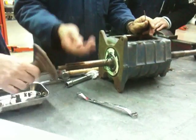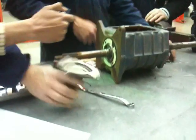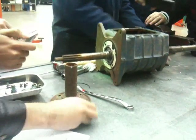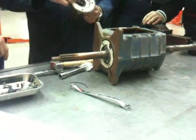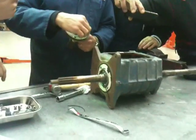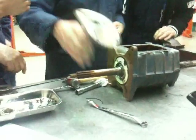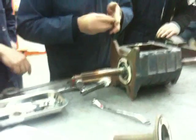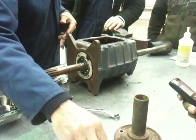When they put those together, they just lock the planetary gear set up. And inside the front here there's a little seal inside - that seal stops oil getting out the front. This has all been put together with silastic. I'm not a big fan of putting gearboxes together with silastic. You can get some stuff from Loctite which is called an anaerobic.